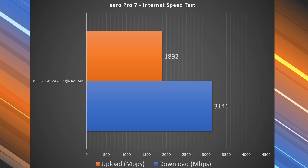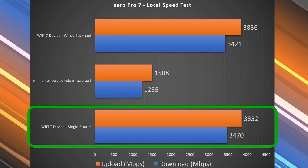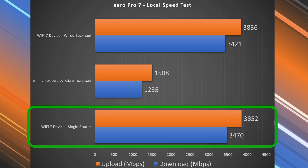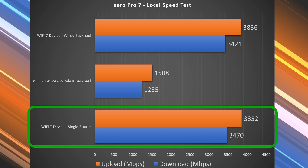To find the true performance of this mesh system, I do a local speed test server — going from Wi-Fi device to router to computer. For the secondary node, I go from Wi-Fi device to the secondary one, which jumps to the primary one, then goes to the server. This way I'm isolating the mesh system and not relying on my ISP or a public speed test server, which can vary depending on time of day and load. We saw overall drastic improvement, especially on the upload section. I was actually surprised — 3.85 gigabits per second on the upload. The download I was expecting to go faster, but the upload I was not expecting to be this fast. Very solid numbers.